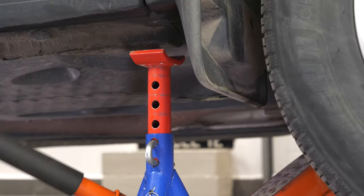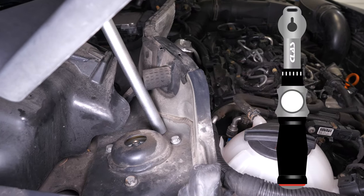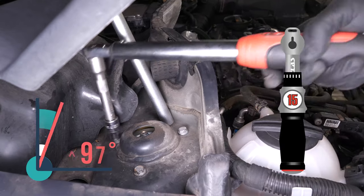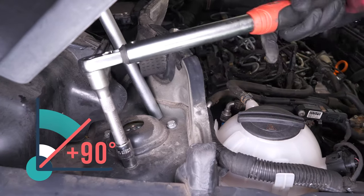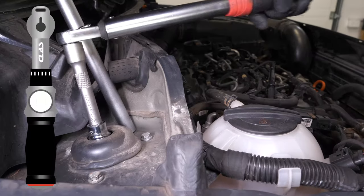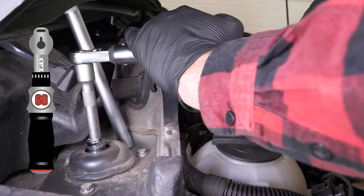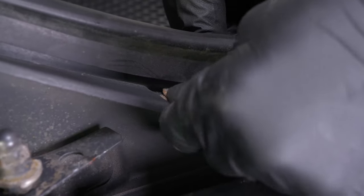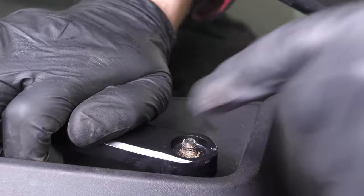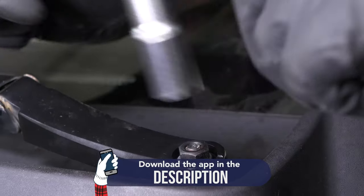Put the wheels of your vehicle back on and lower it to the ground. Screw back the three screws on the shock head — the final tightening should be done with a torque wrench. Finish tightening the core screw with a torque spanner. Put the windscreen frame back in place and replace the holding clips. Reassemble the windscreen wiper arms without over-tightening. Operation completed.